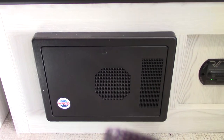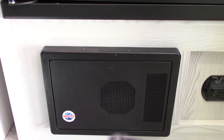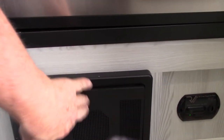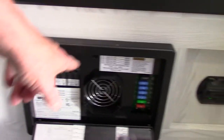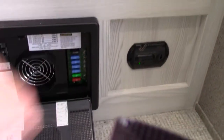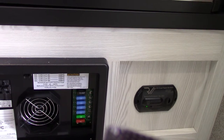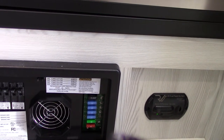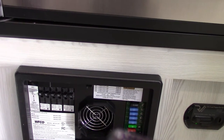This device down here is the power converter. What it does is convert 110 AC to 12 volt DC. Everything that can run on 12 volts DC in a trailer does — some things have to be AC, like the air conditioner or microwave, but anything that can run on 12 volt DC, does. On this side you have regular household circuit breakers — that's 110 AC, all labeled. The power is converted over to 12 volt DC on this side, where you have 12 volt fuses, all labeled. That's where the 12 volt power comes from. As long as you're plugged in, this creates all the 12 volt DC you need; you'll only draw from the batteries when you're not plugged into AC power.